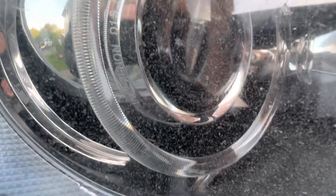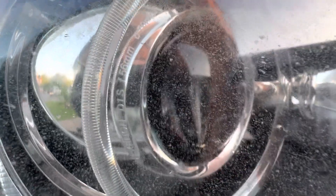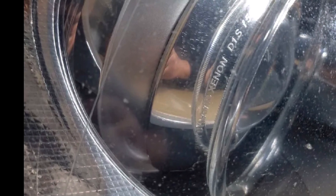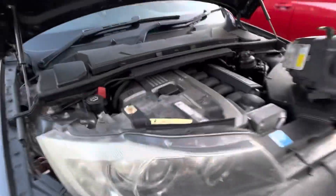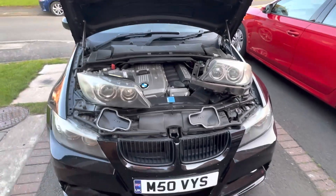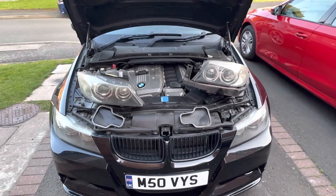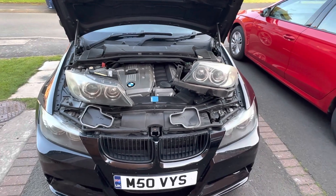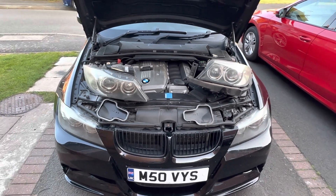If you look on the headlight it says BMW Xenon D1S, F 56mm, diameter 70mm. If it were dynamic it would say BMW Dynamic Xenon Headlight, like in this picture I found online of one for sale. So if you have an E90, pre-LCI models were available with three different headlight options, as were the LCI models, meaning there are essentially six different headlights you can have on the E90 or E91.